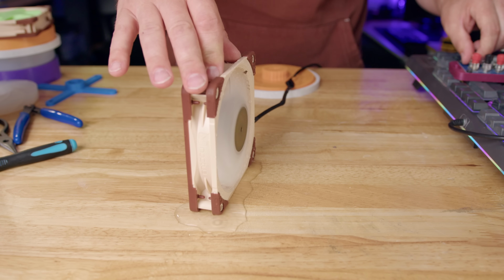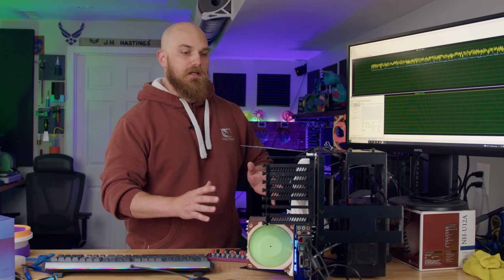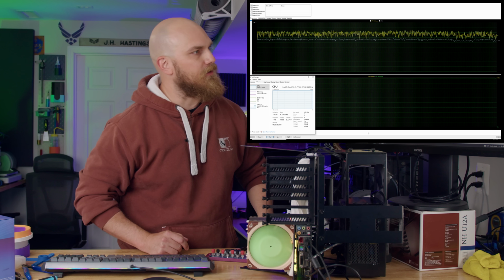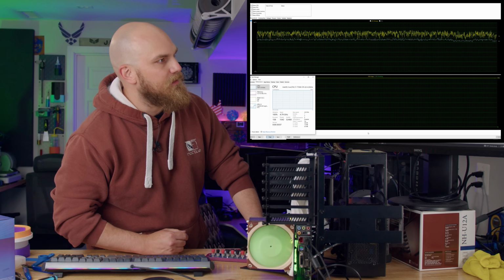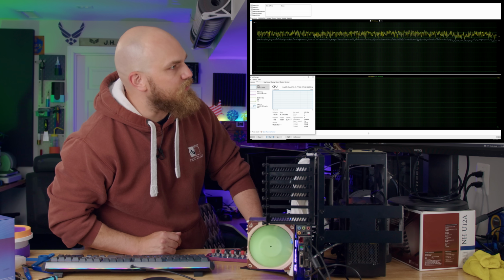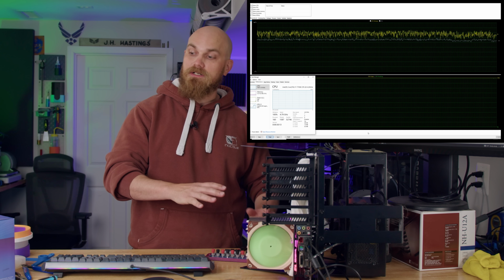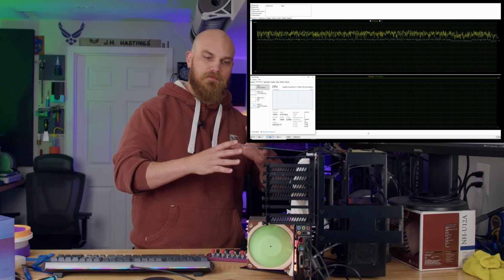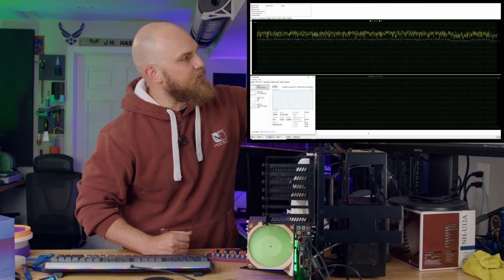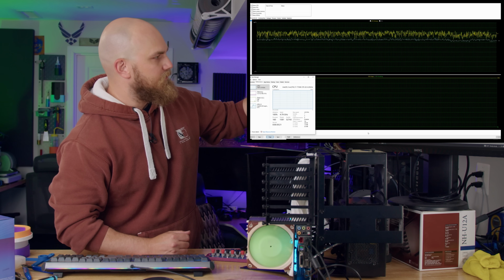So we're almost there. Our PC's like this now because of the water situation that could possibly arise. We've been letting it cook for a while here. The 7700K is at 4.8 gigahertz, and the package is right around 70, 80. It's bumping back and forth, 75. CPU 62. So now we're going to swap the fans to the one that's hopefully a full piece and will remain a full piece when we spin it up, and see if we notice any difference in this yellow or blue-gray line.